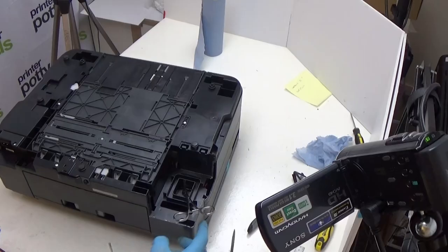I hope that's been useful. By cutting away the sides of the printer I think we've done a much better job of actually showing you how to access this, and because the scanner in this thing was already broken I had no reason to keep it intact — it does have to go for recycling, but it's done a good job showing all the ways you can recover your printer, fit external tanks, and change pads. I'd appreciate comments. I know this approach is probably going to put some people off, but if you just take your time, be patient, and do all the things like cleaning the inside and outside of the tube, you'll maximize your chances of success. I've done lots of these printers and only had one go wrong — that was because I forgot to clean the tube inside and out.